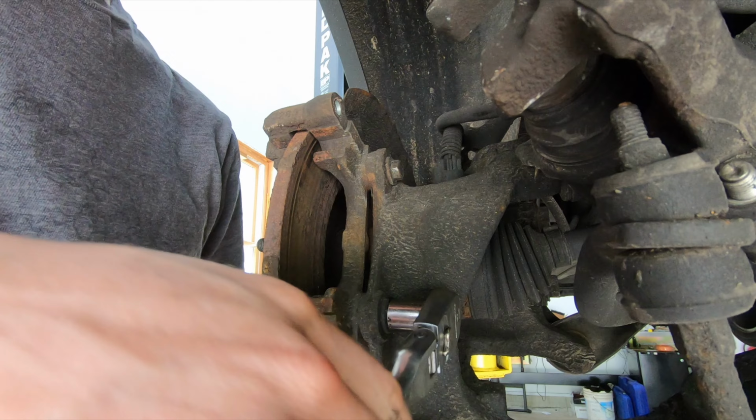So make sure these areas that I sandblasted are all nice and clean. Do whatever you need to do. I would use a file, guys. A wire brush really doesn't remove any material. A file, or I've even used, in a pinch, cutoff wheels on their sides and just dragged them back and forth real lightly.